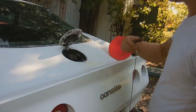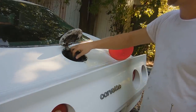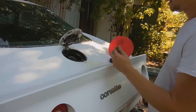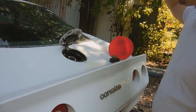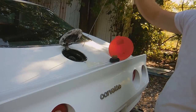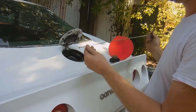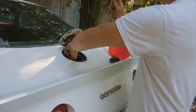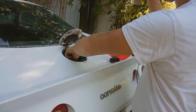All right. Before we go changing fuel pumps, we have to see if there's actually fuel that it could or could not be pumping. The best way I could tell on these later 75 and up gas tanks, since they have a small little neck, is you just need something to stick down in there and see if there's any gas. We've got to remember that they slope downwards in the bottom, so if you go in straight you won't hit the bottom; you have to go in at an angle. I usually use a dowel rod for this, but I don't know where mine went, so I have this antenna mast. So if we push the little flapper and go all the way to the bottom, and pull it all the way back up, we can look at it.